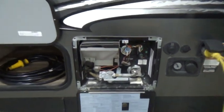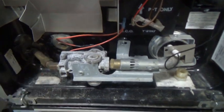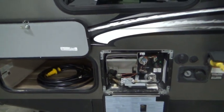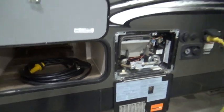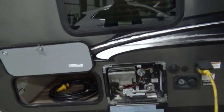Located here is your water heater. Your unit has been winterized, so we've taken the plug out and that plug is here. When you get ready to de-winterize it, you'll turn the bypass valve, which is located underneath the bed, and be able to fill the tank from there.